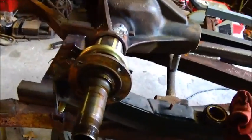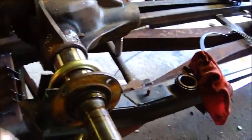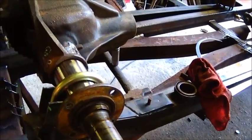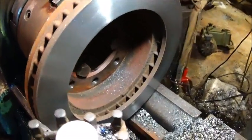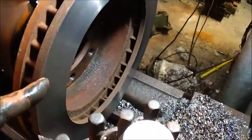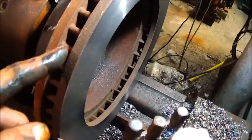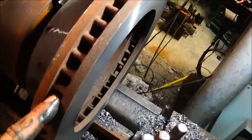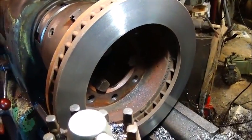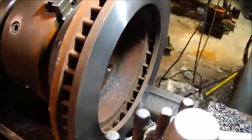Alright folks, we're back at it trying to make the rotors fit the hub and narrowing them down to a single thickness. We've got our rotor set up in our lathe and I'm actually going to turn it down and remove all this center. It's just going to take a lot of time, but sometimes things work like that.